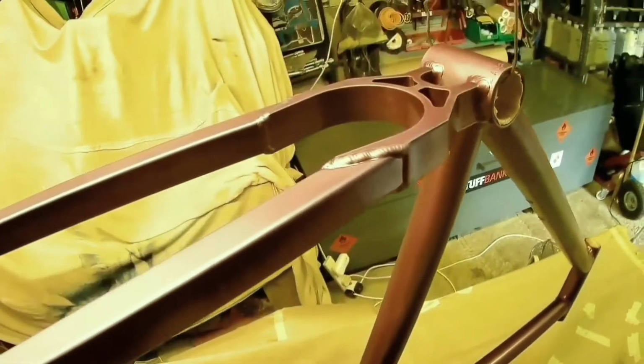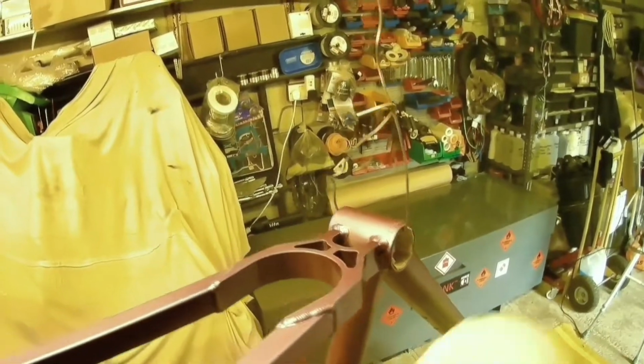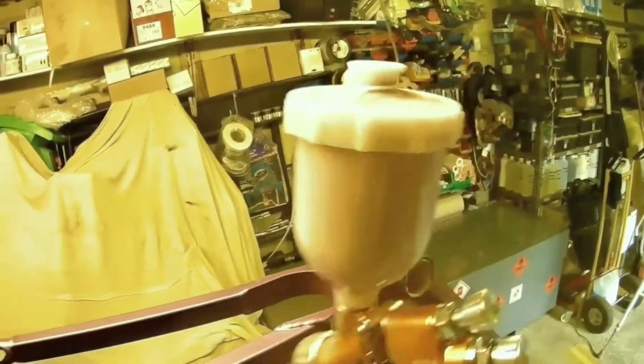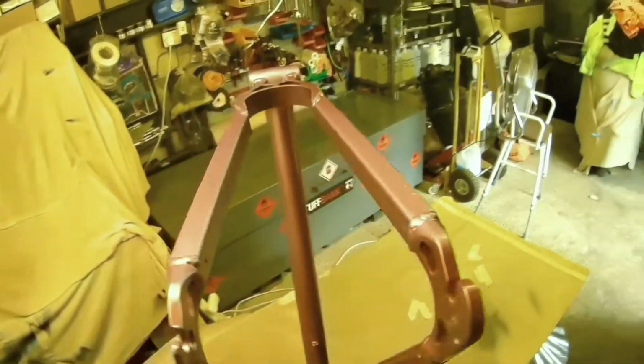amounts of paint being applied to all the areas, and the idea of that is to not get a reaction with anything that's down there before. If you put too much, if you make it too wet, the thinners in the paint has got enough time to react with whatever was on the frame before, and you start to get little fry-ups. So just really, patience is the key.